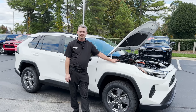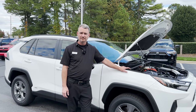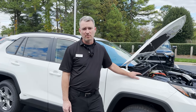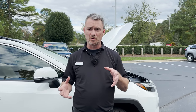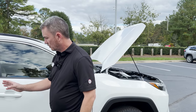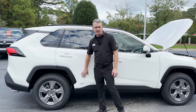We're going to use this RAV4 hybrid as a demo — it's a newer one. What is the difference between a hybrid battery pack and a traditional car battery? The hybrid battery pack is what they call the big battery, also referenced as the traction battery. It's where all the motive force for the electric motors is actually coming from. You've got to think of these in terms of a gas generator, a battery, and an electric motor as three separate components. The big hybrid battery is located near the rear axle of the vehicle, under the back passenger seat.